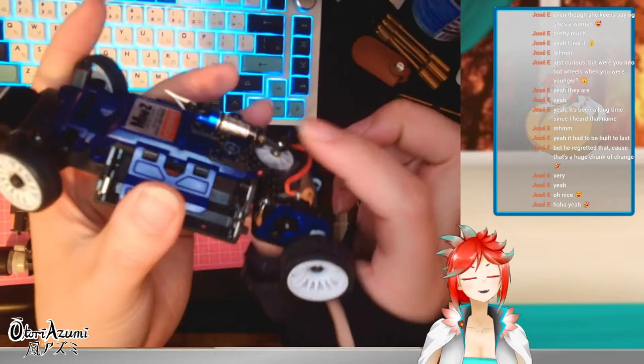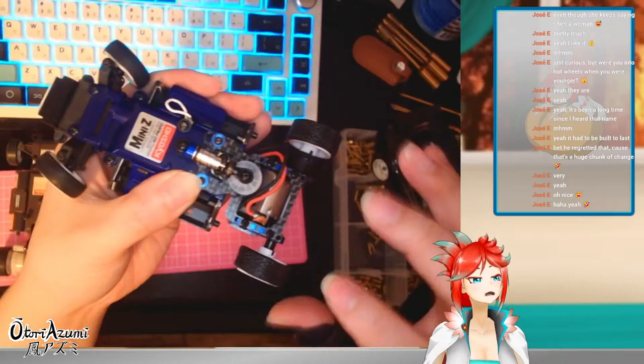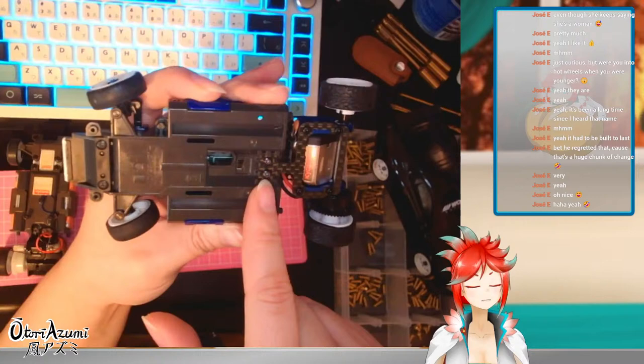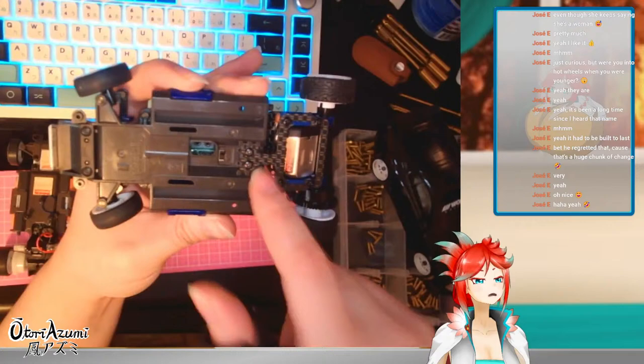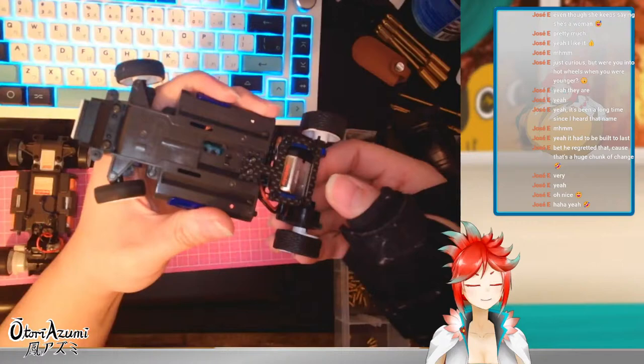Basically, they're trying to use the friction of the disc sliding to slow down the motion of the rear motor pod twisting and compressing. And then the other part is down here. You got this little T, this little H bridge section here, that is actually supposed to flex. That acts as your spring for this, and a little bit for the up and down, but not as much as this main spring here.